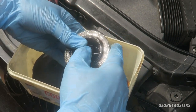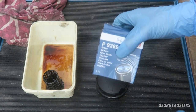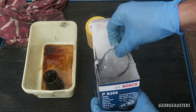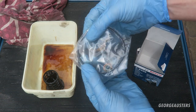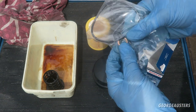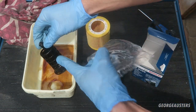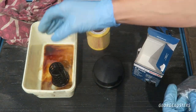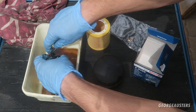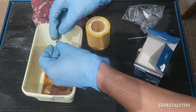Push the center piece out — it's quite a tight fit. There we go. This is the filter element we throw away. Opening up the new oil filter kit, we have the filter itself and a few seals: a large one for the cap, a new copper washer for the sump plug, and a very small O-ring for the center piece — that one needs to be replaced. We'll remove the old small O-ring first — that's taken off.